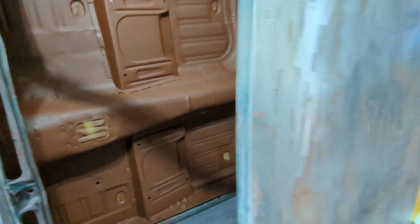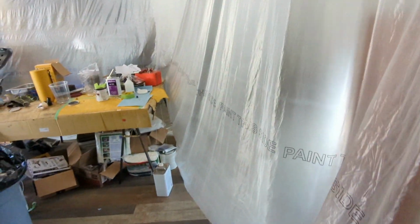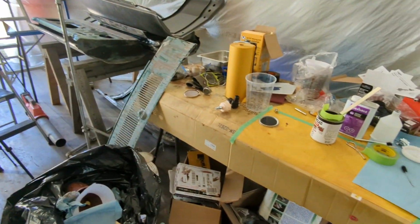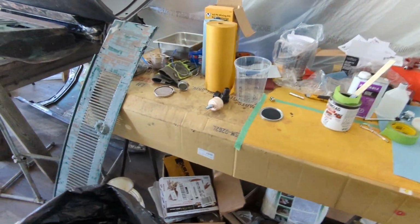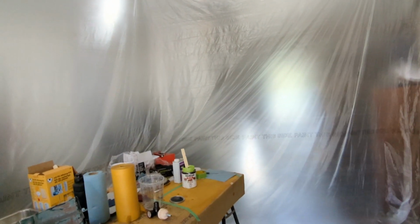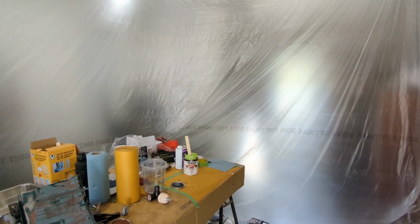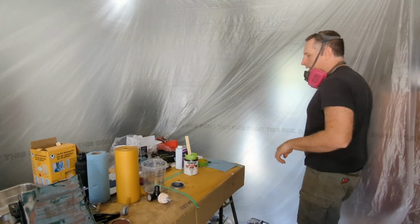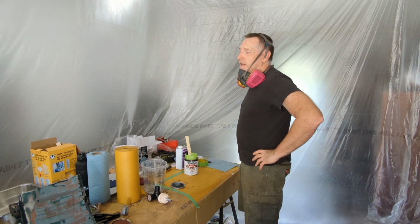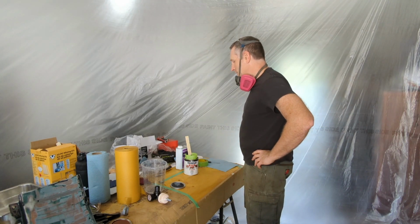It's dry. I gave it a wipe with a tack cloth before I do it today. That's done already, so I'm just ready to mix my paint. So yesterday it was pretty thick going on, and I should have done this before I started painting, but I went on the old internet on YouTube and figured out what I did wrong. Instead of just reading the can, which I thought would have been appropriate, I found out that it has to be mixed. One guy said 4-3, and another guy said 3-1 was good, or 2-1 was okay with acetone.